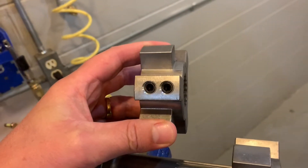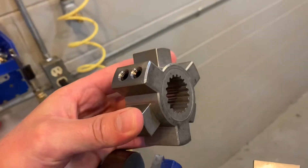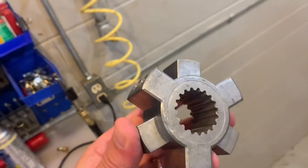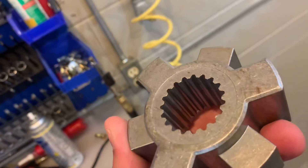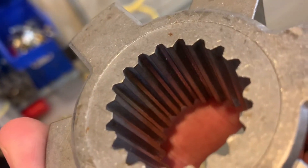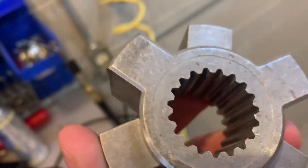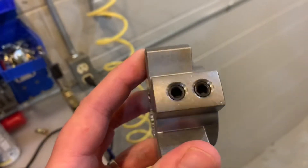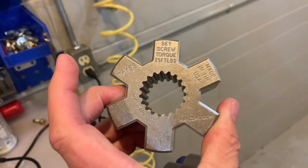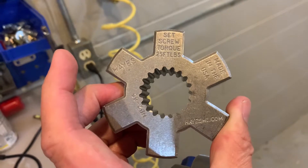When you receive the Hayes HexFlex hub, you'll notice two locking screws in these smaller hubs. If you're using a larger hub you'll see four locking screws. When you look inside of the spline, what you will not see is a hole that goes all the way through for that locking system. That is intentional. The locking system is in the bottom of these holes, and you will get an explanation on an insert that's placed inside every shipment for the set screw torque.